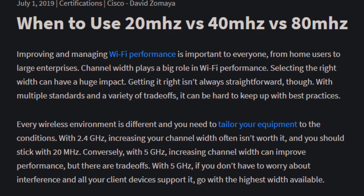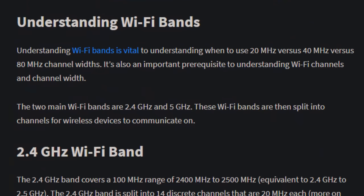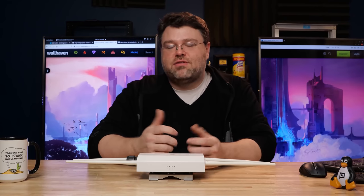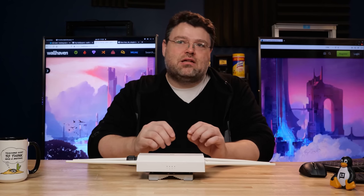There's also the channel width setting, which I tried to set to 80MHz everywhere I could — a lot of the time out of the box, these devices are configured for 20 or 40MHz channel width, which hurts throughput testing. I also wanted to include the UniFi Wi-Fi 6 Lite for this comparison — that's only a 2x2 solution — but I had trouble keeping it going; it kept wanting to go to 2.4GHz and stay out of 5GHz. When it did work, I could get it to 810 Mbit for Apple devices, which is not bad, but still slower than Ingenius. The Meraki is an 8x8 device, which is clearly meant for density, not speed, because the speed here isn't great. Perhaps this class of device is less desirable than it once was as a speed demon, but I'm sure you can pack on a lot more devices.